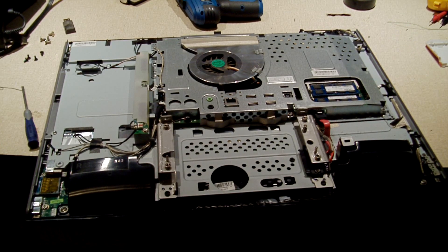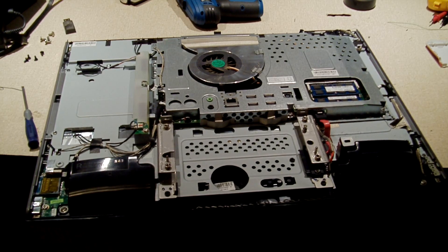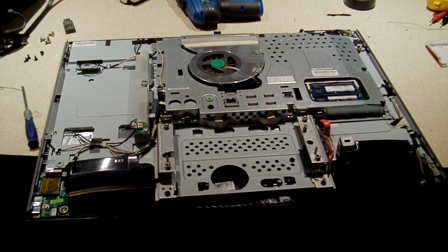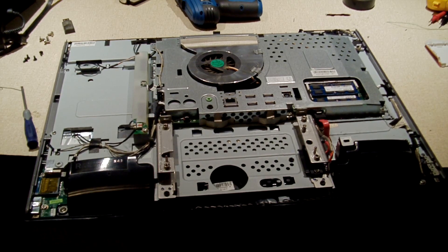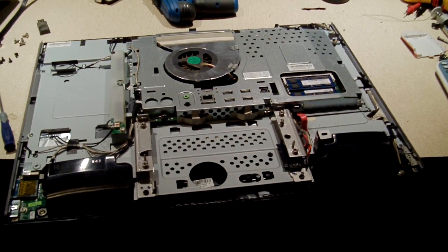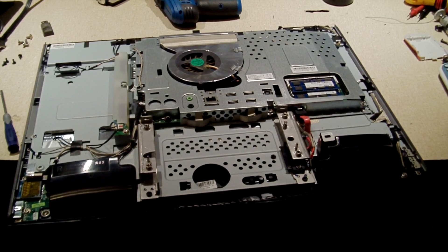Finally we're inside this thing. If you've watched any of my previous all-in-one videos, you'll know that the good majority of all-in-ones out there are, at their core, laptops with a couple of desktop components. Sometimes they'll have a desktop CPU; most of the time they will have a desktop hard drive, but they'll use a laptop optical drive and laptop RAM. I like to call these 'desk books' — not notebooks — because they're essentially a notebook that's flipped up and has a monitor in front of it. And most of these, when the motherboard fails — not if, but when the motherboard fails — you can't just go out and buy a tower and plug it up to the monitor on this and use it.